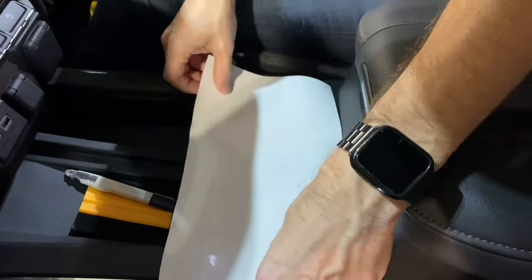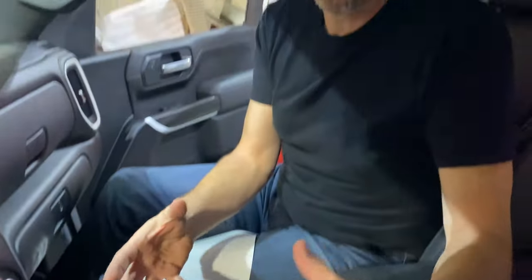We've got all the back areas done. I'll have a closer look at that later. I'm going to focus on the front now. Remember — I'm showing you how you could apply vinyl without taking everything apart. If I really like this, I may take the time down the road to pull every piece apart and wrap it a little further so the vinyl can go around the back of the item and, under the pressure of being put back into place, help hold those edges that might have a little more tension on them. The idea is not to put a lot of tension on the edges.